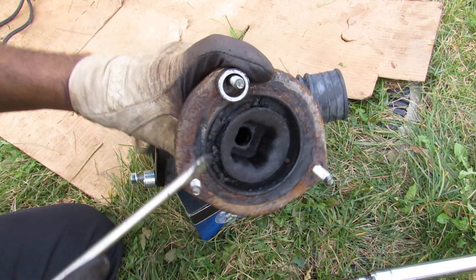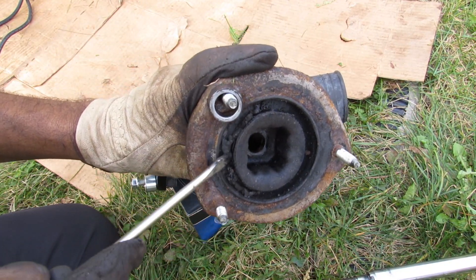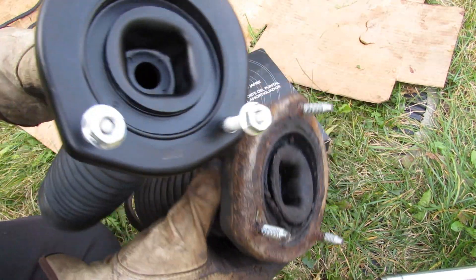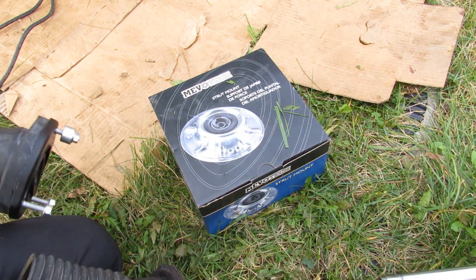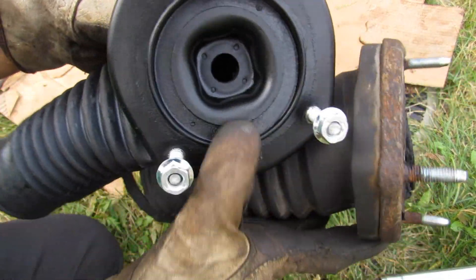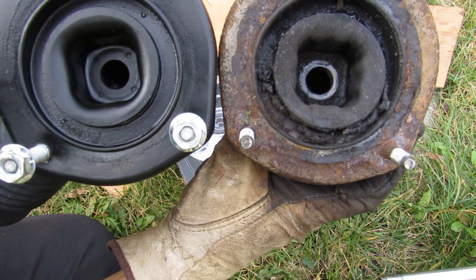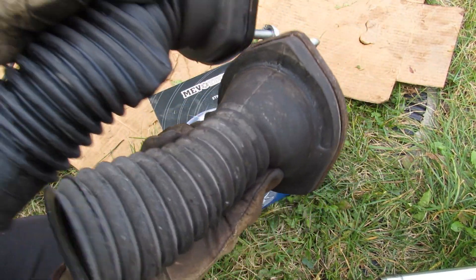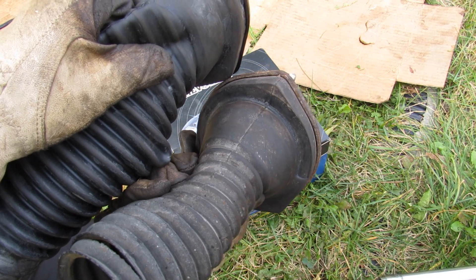You can almost pick the bushing up with a screwdriver. It looks like the previous owner actually tried to quiet things down with some silicone, but this is what's causing all that clunky noise at the back. This here is a new mount from MevoTech — it's got a nice bushing all the way around. Compared to the old mount it looks exactly the same; I just need to make sure I line up the orientation of the spring at the exact points when putting the strut back together.